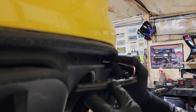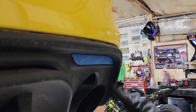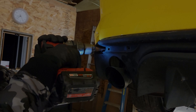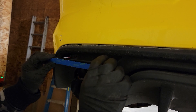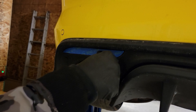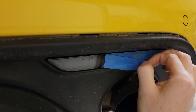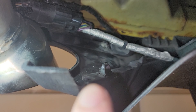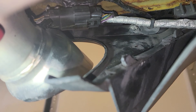Now that the hole is drilled, you can install your light. Do the same thing for the other side. Now you're going to put that plastic nut back on that you took off your old reflectors. There we go — you've already got that clip in on the back there, and then we're going to get to wiring.